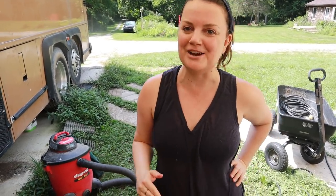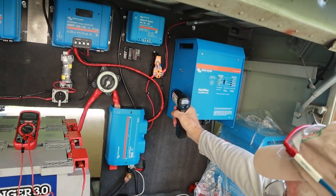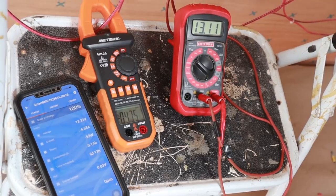Today, Facebook reminded me that two years ago on this day, we posted the trailer saying our demolition series was about to start. Two years later, we finally have power. We are at a milestone on working on the bus — we should be jumping up and down right now and cheersing. It is so stinking hot that we are struggling to show our enthusiasm. But inside here, we are rejoicing, I promise you. We now have our Battle Born GC3 batteries hooked up to part of our electrical system. Our 12-volt DC lights and fans are running inside the bus, all from the power of the batteries, and they are being charged by our solar panels on the roof.